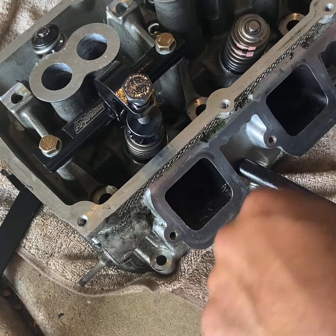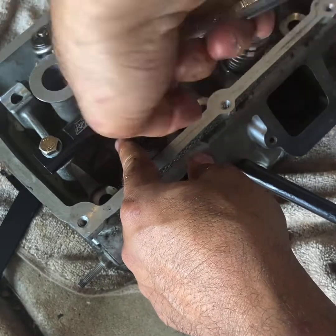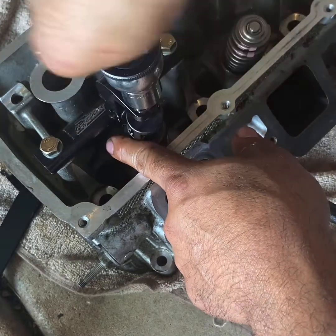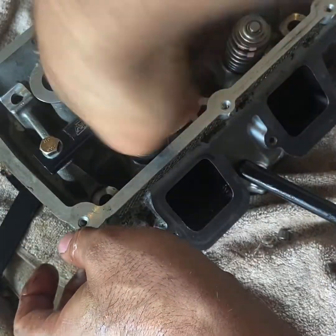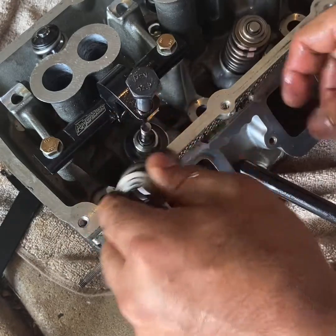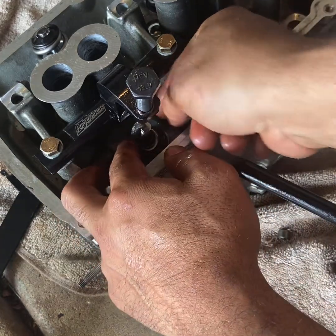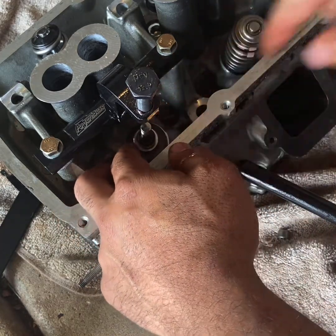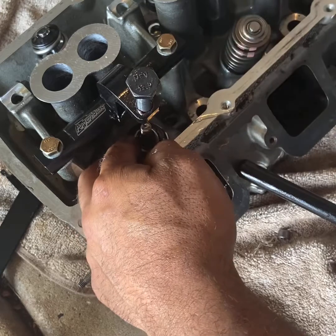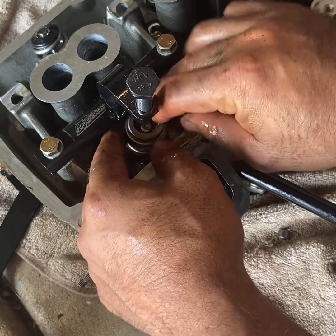I deleted the MDS and replaced everything with Hellcat lifters, so I'm pretty happy with the work. The quality parts I received are a big step up compared to what Mopar uses — it's kind of scary to see those things fail over time. I don't know if it's an oil change or maintenance issue, but I wanted to eliminate all those problems. These Hemis are pretty strong motors, but I just wanted peace of mind having the best of the best installed.